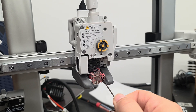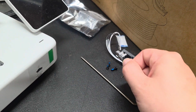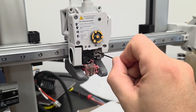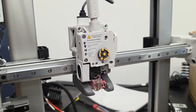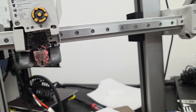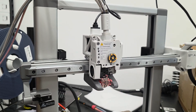So the first steps are going to be: remove your nozzle. Then you can also remove these three screws here — they will also come with your replacement part. This part here has a big long cable that goes to the back, so we have to get to that. It's only three bolts to get this off, which keeps our extruder assembly together but unmounted from the X assembly. That's important because the little cables just come right back up in here. I'm going to try to do this without taking the fan off — I don't think we need to. The fan's only two bolts anyway, not a big deal if we do.